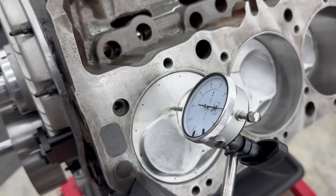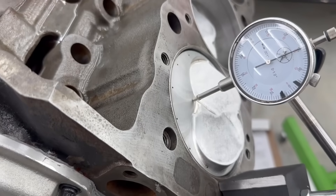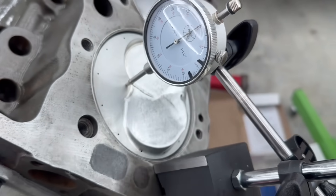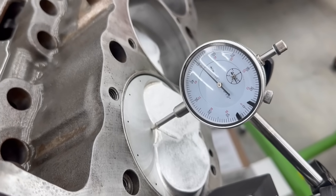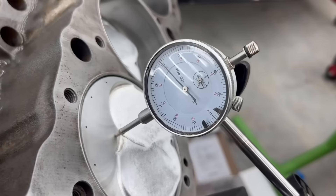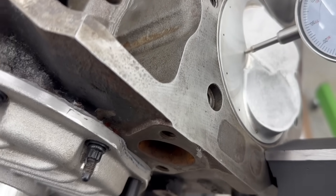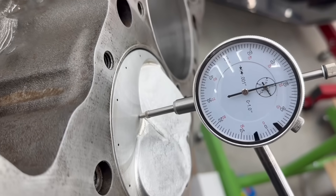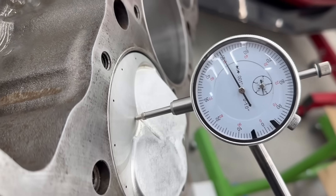So I'll go back about a hundred thousandths past — you can see we're at 20 degrees before top dead center. I'll run it up to where the indicator is on zero, meaning the piston is as high as it's going to come. It dwells there, and that's where you can get messed up. We'll run it to 50 thousandths before top dead center — which is at 10 degrees — then continue through to top dead center. Then we run it back to 50 thousandths on the other side.